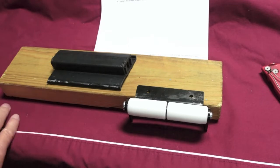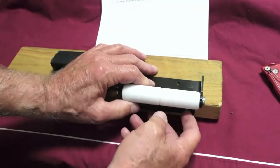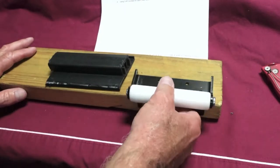Lippert makes some rollers. Lippert makes slides. There are all kinds of manufacturers making these slides, and they all have different roller assemblies. Some of them, the slide has to be out, and this is on a flat bracket, and it's just mounted right onto the floor with no side at all. To me, that would be ideal, in conjunction with a wear bar built from the factory.